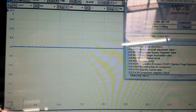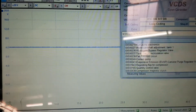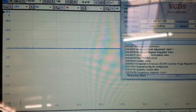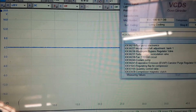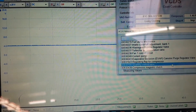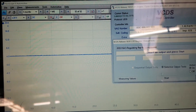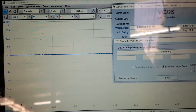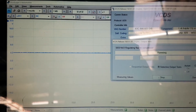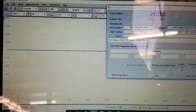So I'm now back-pinning into the earth and the signal from the potentiometer — the position of the potentiometer will give a voltage. Obviously we've got a 5 volt reference, so the maximum we could ever give would be 5 volts, but that is only for diagnostic purposes. So let's say it's 4 volts at its maximum end stop, and we'd probably drop down to half a volt or 1 volt. So we're just going to do an output test and watch and see that it doesn't actually change, because if we were to move that flap that value would change if the potentiometer is working. Then we'll try and read the duty cycle going to the motor as well.